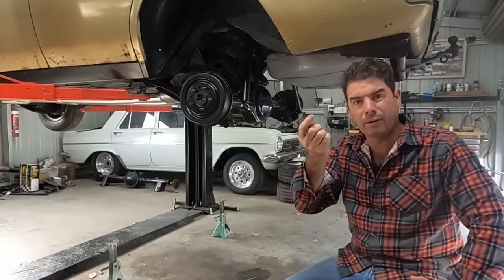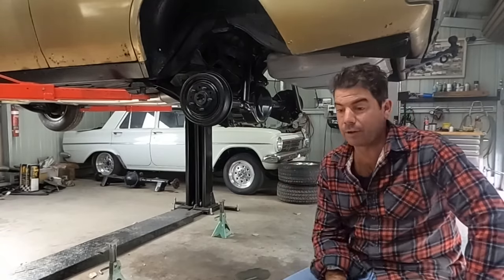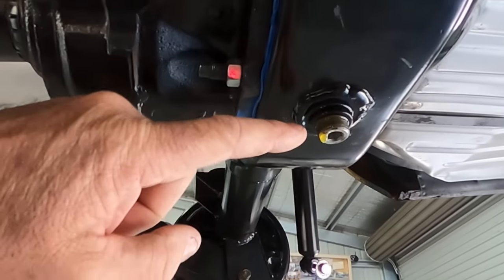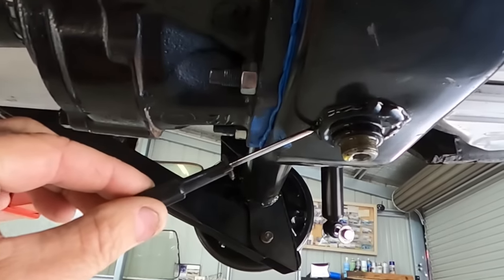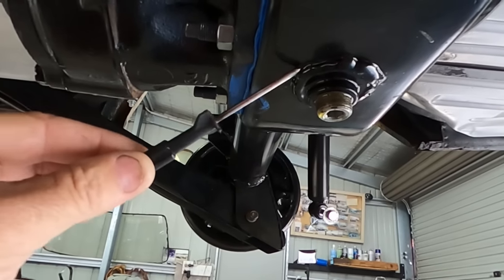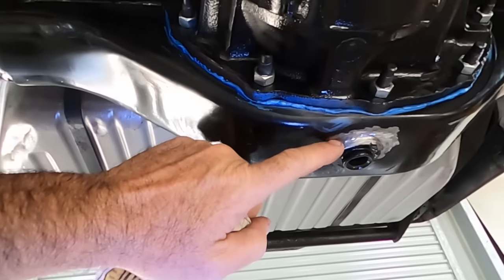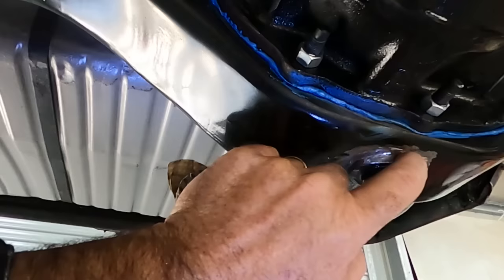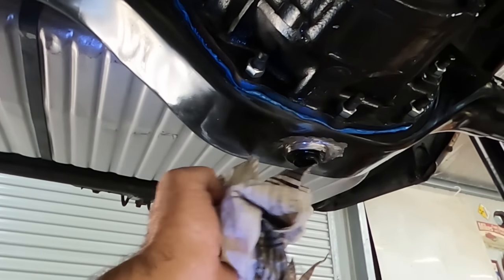It's actually the weld that's around the drain plug, which a drain plug in a performance type of diff is a good idea, but right now we're not friends. I don't know how well you can see it, but it's not the drain plug itself. Now I've loosened that, I've re-drained the oil out. It's actually right there. That weld there, if you can see, that's got oil on it now. It's leaking there, so I'm just going to grind all around the face of that and just run a weld around it. So I've ground all that up, but if you can see, there's still just an edge of oil there, so I'll just have to wait. I can't get it clean enough to weld. If I try and weld that now with that oil residue there, it's not going to weld properly. I'm going to be fighting with it, so we might get onto everything else first and come back to that.